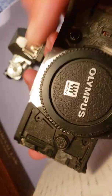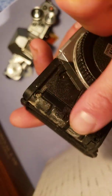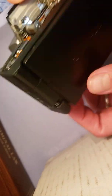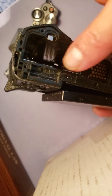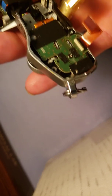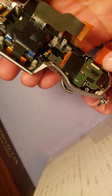The screw points for the front — I believe there are maybe three screws that have to be removed. Once you have removed all the screws, there are also two screws that are inside. There's a middle one that's right inside the spring at the bottom, but you don't want to remove that screw you can see through the spring at the bottom, because that's actually connected to this plate here and is holding one of the circuit boards in place.